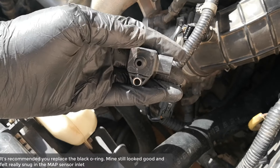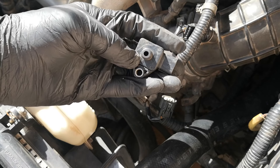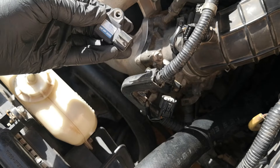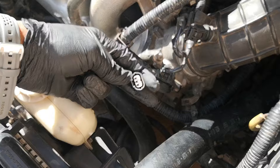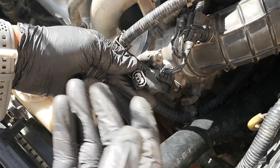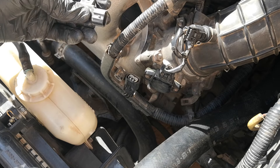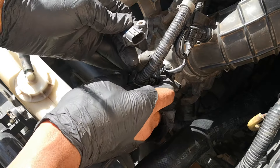While that's drying, if you're having any MAP sensor-related codes — P0106, P0107, P0108, or any other MAP sensor-related codes — beyond cleaning the MAP it's good to ensure the connections and pins are not corroded. Check the connector itself and make sure it looks in good condition, because poor contacts can cause any code in a modern car. So those are things you really want to rule out before you start changing your MAP sensor. There's also a procedure for testing the MAP sensor, but I'm not doing that in this video.